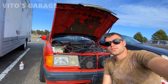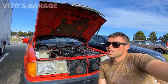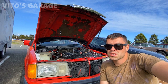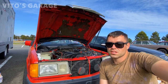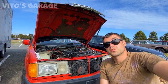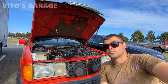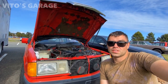I hope you enjoyed this video and found it helpful. For those wondering why I didn't do a full flush — the fluid was actually pretty clean so there was no huge need for it. The main thing is that I did the service: dropped the pan, cleaned the pan, changed the filter and gasket, and put fresh fluid in all the way up to the max. That's the most important thing.